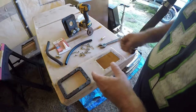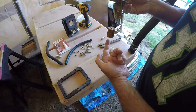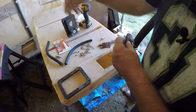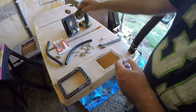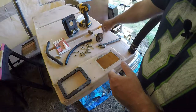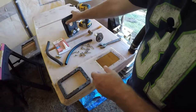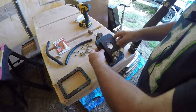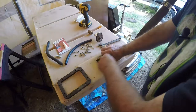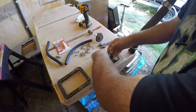This gets down right on the bottom of the tank as well. You can't put this on until you have it positioned in the hole, and then you can set it in and screw it on. If you try to put it on and then try to get the whole thing in there, it's not going to fit. So I'm going to put this back together — it fits inside like this, then you put it down in the hole and turn it around, pulling the pickup tube up a little so you can get it in there.